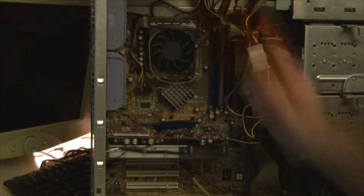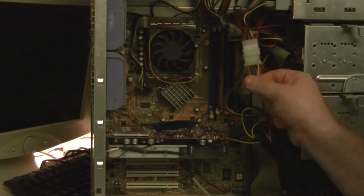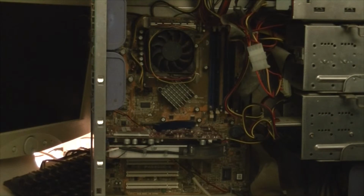Turned out that the power supply I had, which was ironically a 500 watt, had nearly, I don't remember the amps, but it was so light. The wiring was very flimsy. Sometimes the board would not even post. And so I'd assume it was probably like a 7 amp power supply with a Radeon 9600. Well, it kind of, you know, wasn't stable.